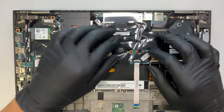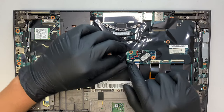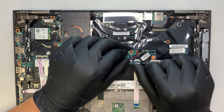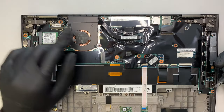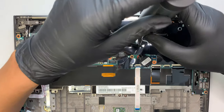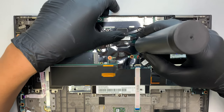For those of you who ask where the CMOS battery is — your CMOS battery is on this one right here. It's actually a disconnector, and if you want to disconnect the CMOS to reset your BIOS for whatever reason, you just have to push out the pin to reset it. For my case, I'm going to replace the CPU fan — the CPU fan and the heatsink are all together in one piece. First of all, I need to remove the screw. Just so you know, the screw does not come out, so just unscrew it.